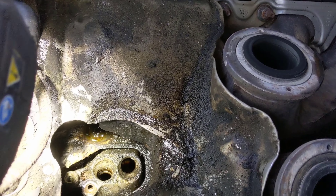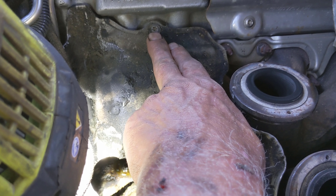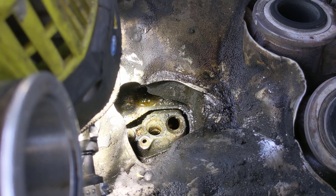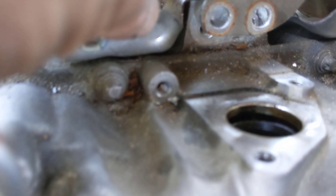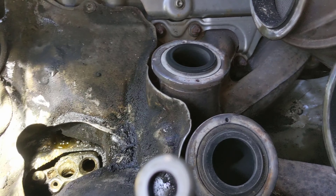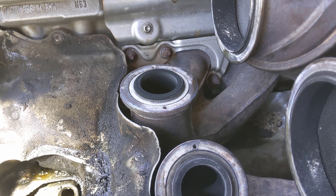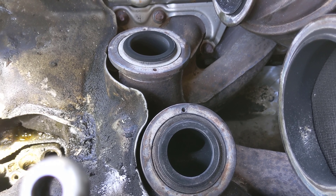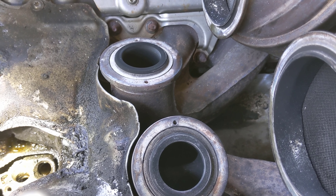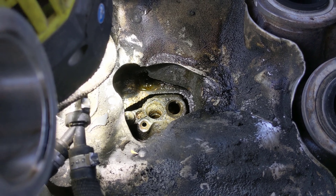The turbos are off. You can see down in there it looks a bit oily and messy. We're going to take this shield off — there are just a couple of screws inside and two up front. Also, an important tip: make sure you put something in your exhaust pipe holes. I once dropped a washer down inside an engine and trashed it the first time I turned the key. It only takes a second to cover up the holes — you don't want to have to pull a head off to retrieve something.